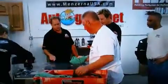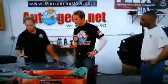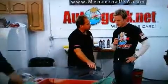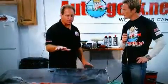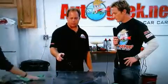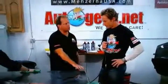All right, Mike, I got a quick question for you. There's some blue tape laid out on the hood, and I have an idea why it's here, but why don't you clarify for the people at home? Good question. The reason we put the tape down, this is the 3M vinyl tape, is every place you see this tape is a raised body line. As you're sanding, we get some white slurry, and it can be hard to see where those raised body lines are. A lot of times, because of gravity, the paint will flow over any of the high points. It'll be thinner there, so you don't actually want to be sanding on the high points. The blue tape protects the raised body line, and it's a visual indicator to show us where they're at when you start getting all that slurry on there. Yeah, you can kind of lose focus of where you're at, and if you hit those high spots, you could be in trouble. Yep, and we also taped off all the edges here too, about a quarter, maybe an eighth inch in, again just to protect those.